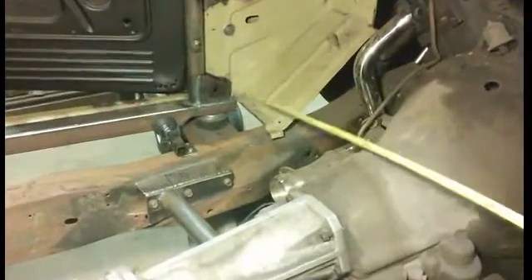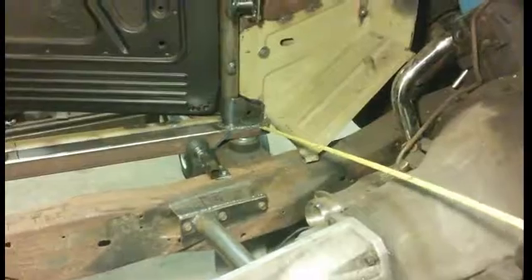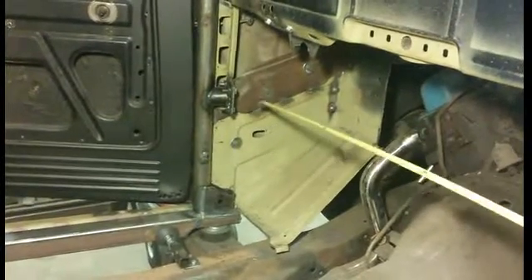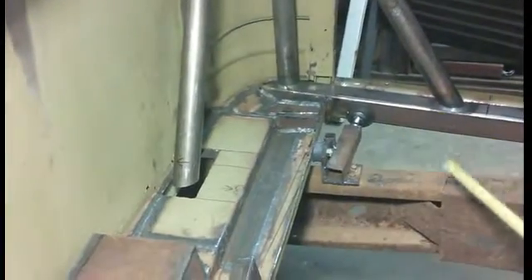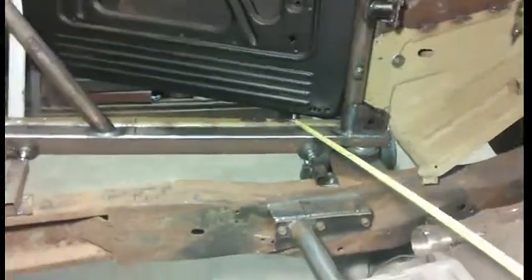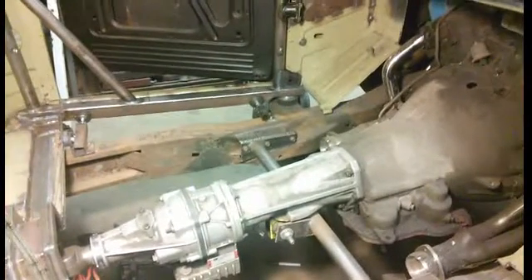I made these brackets and put a piece of tube back on the bottom to get rid of some washers — it stiffened things up a lot. I also made these flanges up here that will continue up to the firewall and connect the cage to the front. Back over here I still have to cut the back of the cab out, connect these, and put a piece of eighth-inch in this whole area. I found some feet over here that I'm just going to leave in because they really hold everything where it's supposed to be. The thing is pretty much welded in, the hood lines back up again, so now it's time to finish the cage off and cut the back out of the cab. I'll catch you on the next video.